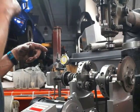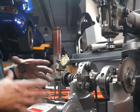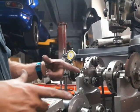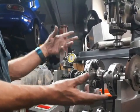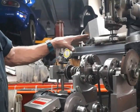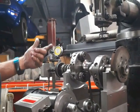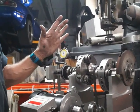But on these engines, and that's another thing, those bob weights are like V blocks. They come together like this. They bite the crank, and then you start adding washers to it. On this, it's just totally different. You saw me go through the whole operating setup of the bob weights. But when you're spinning the rotor, you're dealing with two planes that have a natural wobble.